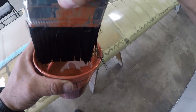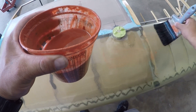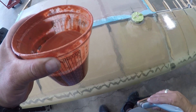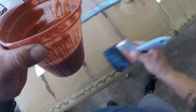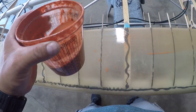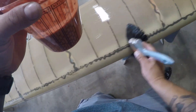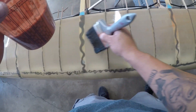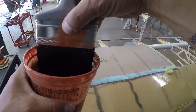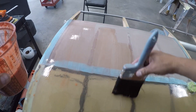We've got the wing here ready to cover, and the very first step is going to be to do a pre-coat of poly brush on hard surfaces where fabric is going to ride on. Basically the leading edge, and also in this case I would pre-coat the fuel tank area for a Kit Fox wing. Here you can see I've got the poly brush mixed and ready to go, and I'm going to go ahead and do two pre-coats of poly brush on the leading edge and also on the gas tank area.